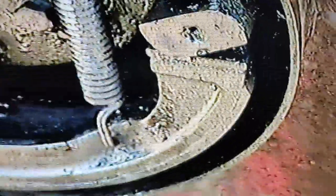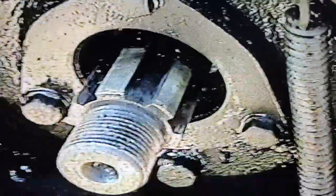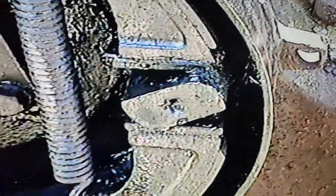I'm going to add some footage because I haven't put the camera away yet and I kept working on it. I cleaned up all the grease out of it with gasoline, put a drain pan here underneath it — it stuck in there and worked good to catch everything. I used my parts cleaner brush, a little steel brush, and I just kept going at it. I kept thinking: if it's not rusty, then either this anchor pin is stuck or the cam on this side is stuck. The cam is worked by the brake rod to the foot pedal. So I come around and look — here's the cam to the foot pedal. Somebody, when they parked this 60 years ago, locked the brake, because that brake drum was not rusty.